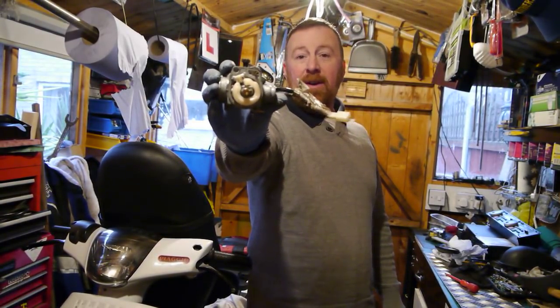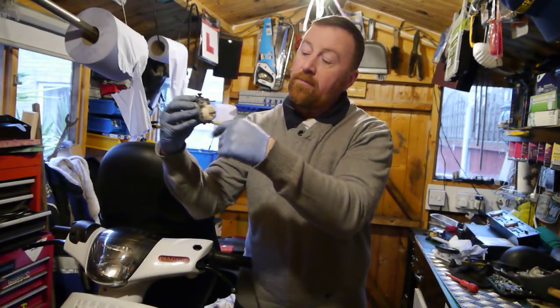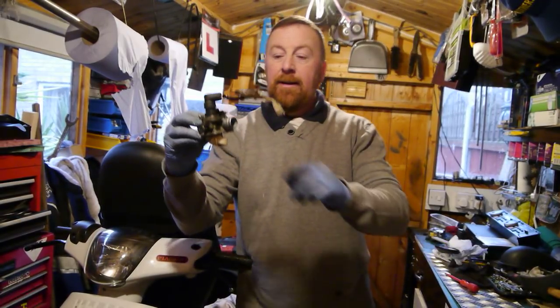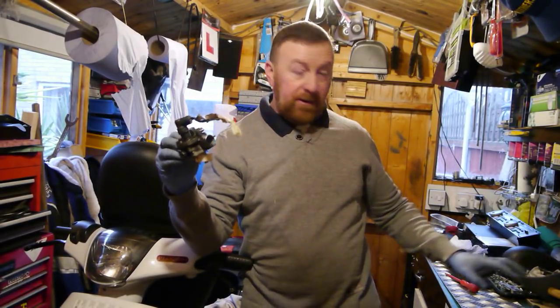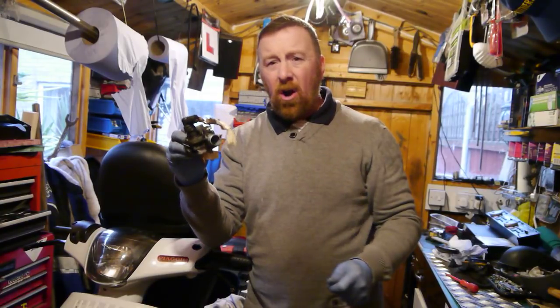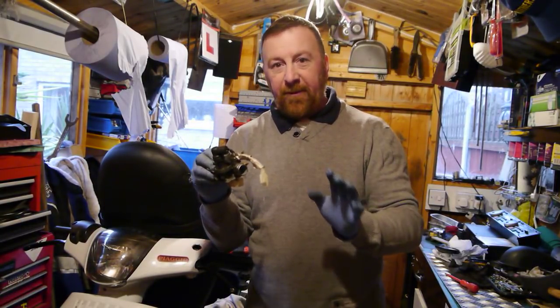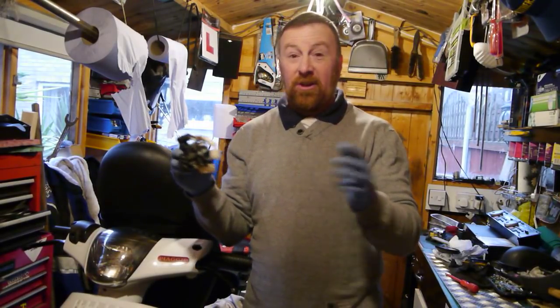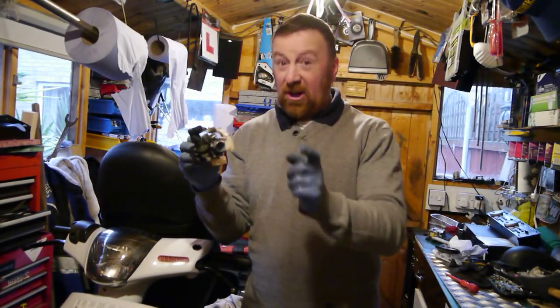What we're going to do today is change this jet. On the bottom here — I showed you before — the middle one is the main jet. Below it is the idle jet, and around here is the fuel. If you're going to take this off, clean it properly. Watch the video showing how to get it all back together. Take this out, put it down, remember where you put the bolts, make sure it's clean. Take out the idle screw, take out the air-petrol mix if you can. Take everything off it, place it nicely, wipe it clean with a clean cotton rag, and spray carburetor cleaner. Remember — carburetor cleaner. Not brake cleaner, not disc cleaner, not WD-40. Carburetor cleaner. They do different things for different reasons; that's why they're not called multi-purpose spray-anywhere cleaner. I'm only saying that because a couple of people said they've got disc cleaner or WD-40 or washing up liquid. They've all got their own set of uses. If it says carb cleaner, I'm happy — it will do the job.